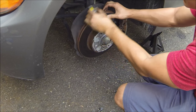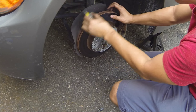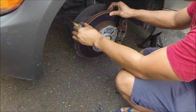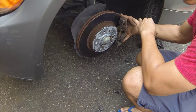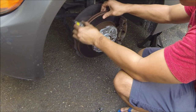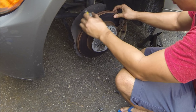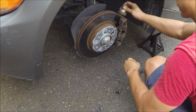If your rust is really bad you'll see flakes coming off — I just see dust, which means the rust is not that bad. The whole purpose of this is to get rid of the rust and have a layer of paint over it, so that not only do the brakes look nicer, but having a layer of paint will also prevent further rust from happening. After you've done the rotors, do the caliper itself as well.